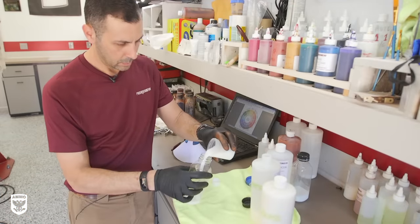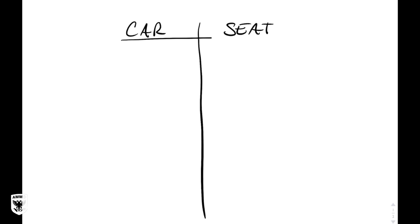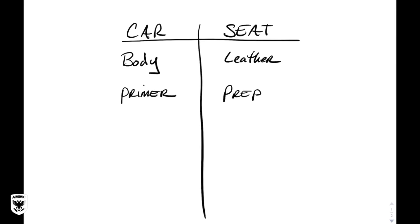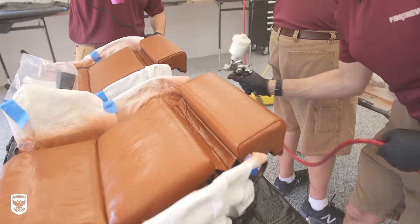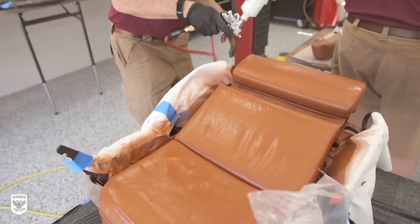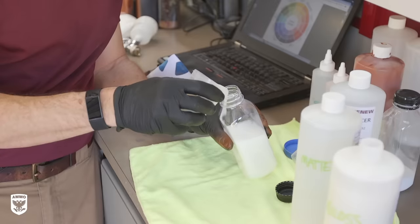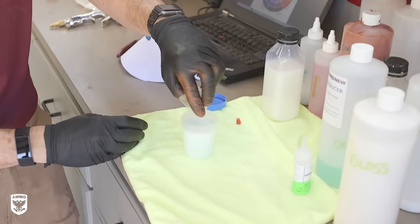The last step of the dyeing process is called the top coat — think of it like your paint's clear coat. The body or metal is equivalent to the leather or vinyl; the primer is the same as the prep solution; the paint is the same as the dye; and the clear coat is the same idea as the top coat. The top coat is where it gets interesting: the seats are extremely shiny right now, but OEM seats have a muted or matte look. Brian can mix any ratio of gloss and matte top coat with an activator to achieve the customer's desired sheen while protecting the finish.